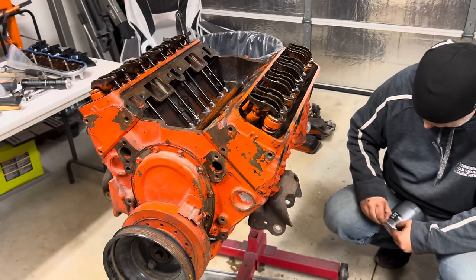Okay, good news. I didn't hear anything crazy, and we have oil pressure. Well, that starter's still not disengaging the way it should, but we'll worry with that later. I had these R45TS spark plugs. Are they the right ones? No idea. Will they work for this? Yes, they will.